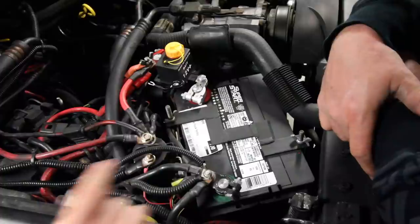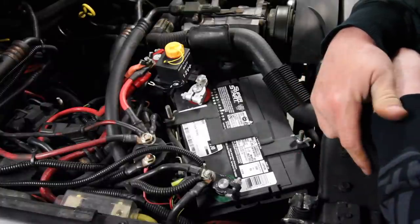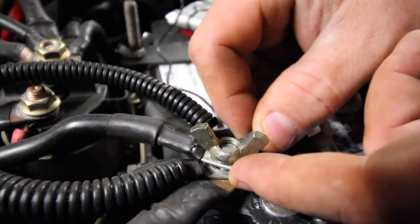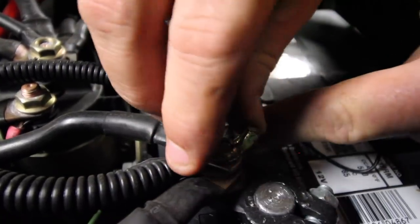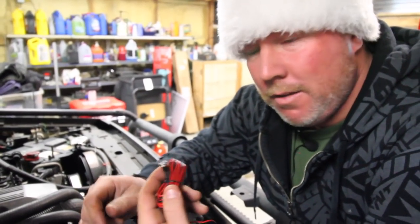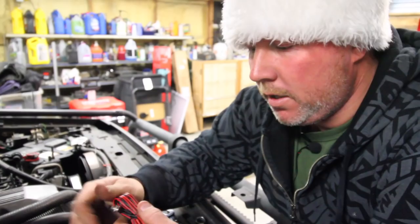There's a ground right there — there are already a lot of wires going to it. There's no doubt this is the zombie machine. But when you are running from the zombies, you've got to have something like this to keep your battery good. That looks like it might work out amazingly. One little key to this thing: this is also partially anti-theft, because if you hold the button for five seconds, it automatically disengages. So you can hide this under your dash, hold that down for five seconds, boom, it kicks out automatically.